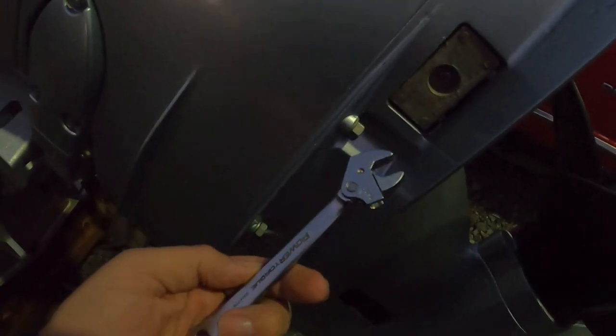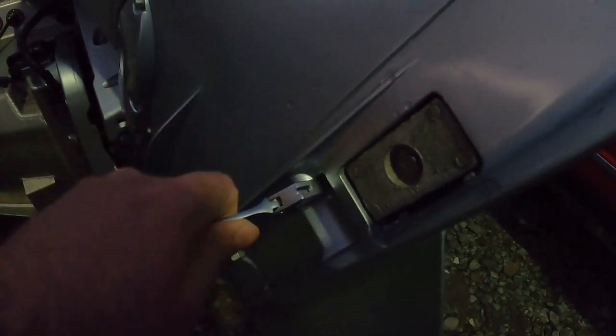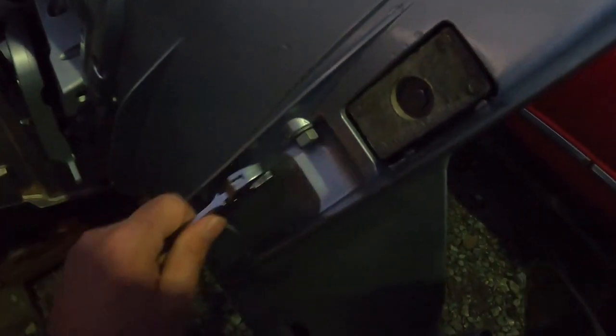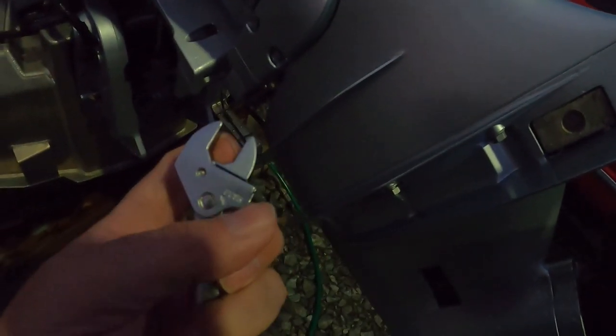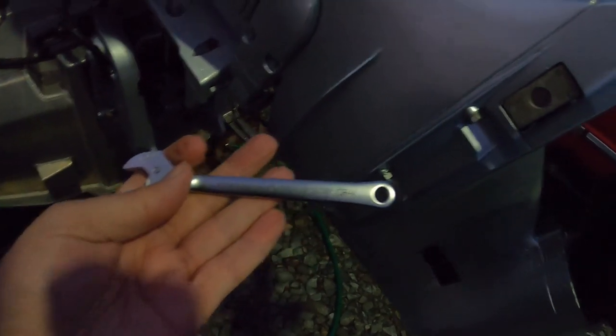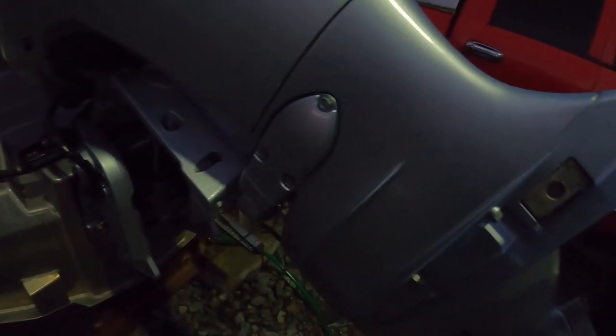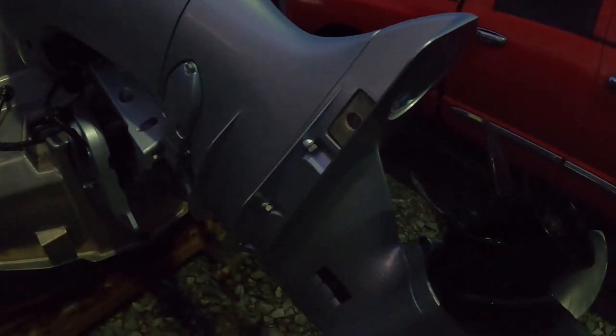This little tool was worth the 17 dollars — well worth it. It busted every last one of these loose even with the thread locker. Once they loosen up past the point of being able to ratchet, it doesn't do much good because the tension on the jaws just spins the bolt back, but you can get in here and turn it quite easily. For a variable-size wrench it's not just a universal rounding tool like you get with a typical crescent wrench. I think it's pretty well worth the money — I'm going to throw it in my tool kit. In a pinch I'd rather have the actual socket size, but in a pinch this works great.